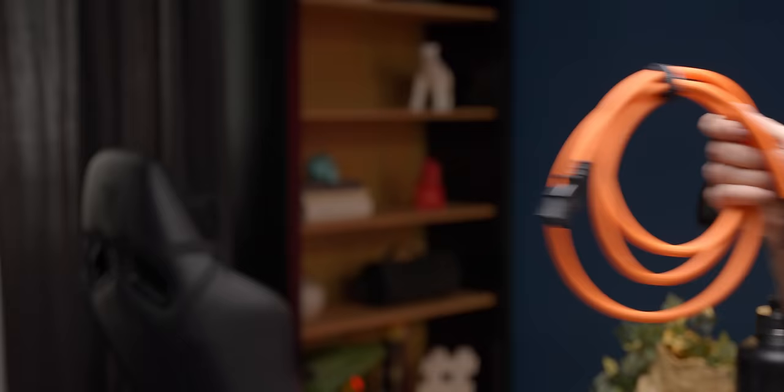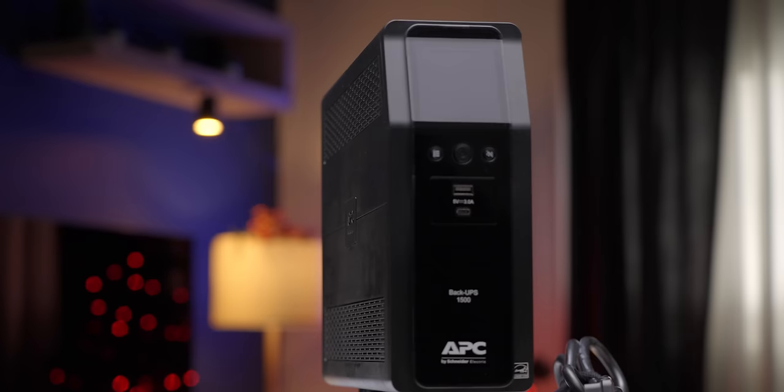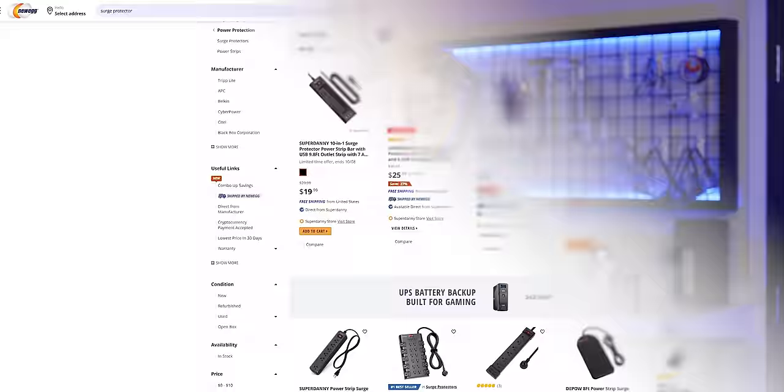Now you're ready to plug in and the first cable is going to be power. This ensures your equipment is grounded and protected from electrostatic discharge. Good PC power supplies can handle a wide range of power conditions, but plugging into the wall or into a dumb power strip can stress it if your wall power is noisy or prone to voltage sagging and brownouts — especially true when other high-power appliances like an air conditioner are running. A UPS or premium surge protector can help clean that power up before it hits your PC or display. Failing that, I'd recommend at least a basic surge protector, which can help protect against voltage spikes from things like a lightning strike.